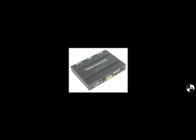Also, the digital TripleHead2Go lacks HDCP support. For most folks, their TripleHead monitors will be their only display, and HD optical drives are soon to be the norm. Even though my graphics card and displays all support HDCP, I'm not able to enjoy either HD DVD or Blu-ray playback. Due to limitations in DirectX 9, the digital TripleHead2Go isn't ready for prime time with 3x widescreen displays. Currently, the max resolution supported by the digital TripleHead2Go is 1366x768 on each of 3 widescreen panels.